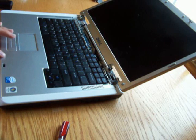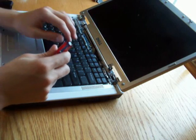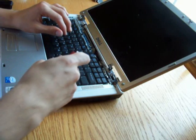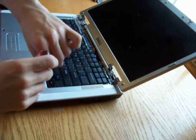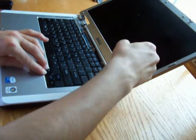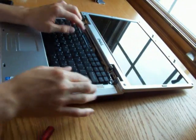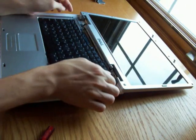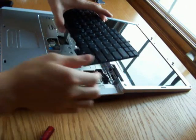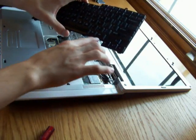This part's a little more difficult. We're going to take our flat head, and on the sides there are little crevices — just try to stick your flat head in there and push out. Find a place that's a little open and just push it forward. It just takes some toying around; you're really not going to hurt anything. We've released the keyboard from the little tabs holding it in.